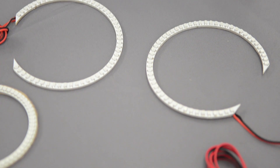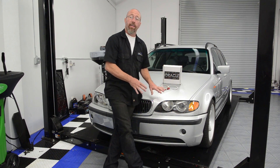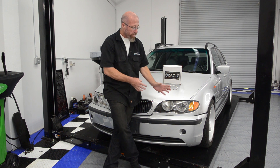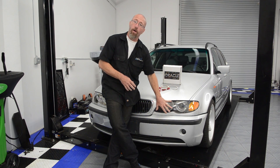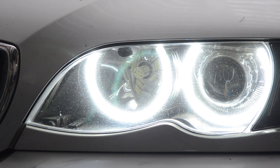What you need to do to install it is you need to disassemble your factory headlight. On our BMW here, that's a pretty simple task. Basically, the headlight cover comes off with clips. You pull the entire headlight assembly off — there are several clips on there. You pull those clips back and then the front cover comes out. Then you just double stick tape your Halo around your bulbs.